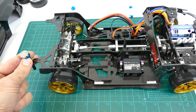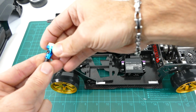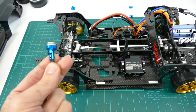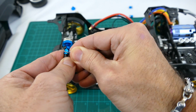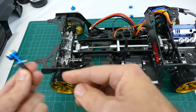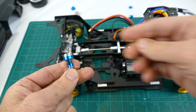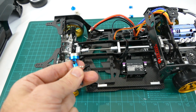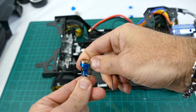So you know where they normally go in the car, the traditional body post, and that's where you put this one. This one simply screws in here, or you can either screw it in or use a standard body clip like this. Let's just put this guy in. I've used these on a rock crawler, and so far so good. And see, that's in there now. This is on a pivot, so the benefit is you can tighten this particular angle up to whatever you want. You get the right size Allen key, screw this guy up, and it's really sturdy.